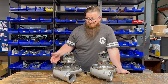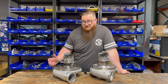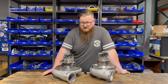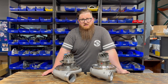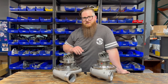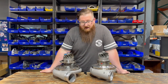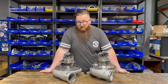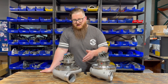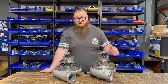When I would use the S500 — probably for 9 out of 10 customers. Why? Because it's a great bargain. They're a little bit more readily available, there are a couple more housing choices, and it really just comes down to price. Prices always change, so I hate saying exact numbers in videos, but right now this is less than a $3,000 turbo with the housing. I think the super core is like $2,200, whereas this Garrett GTX is going to be somewhere in the mid-fives.